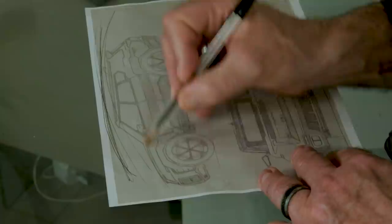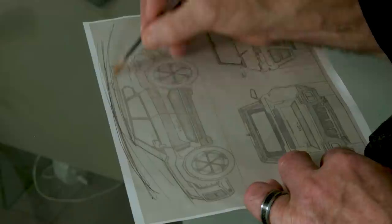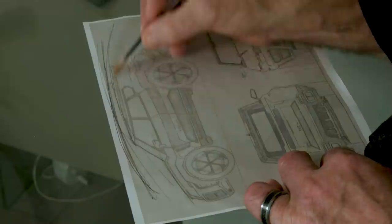Start making curvature from the front of your design — the windscreen, the roof. The big problem with very flat lines is that when you go from a flat line to reality, that flat line will never look straight; it will always look hollow. A flat line doesn't look like it's got any tension to it — it will visually sag, not mathematically, but visually you will have no tension in that line. Add some weight, add some curvature, pump it up a little bit.